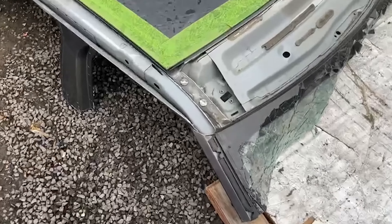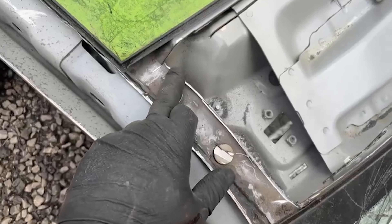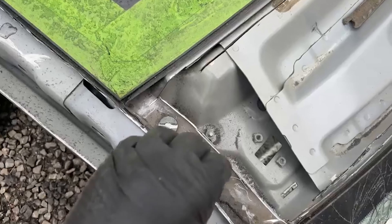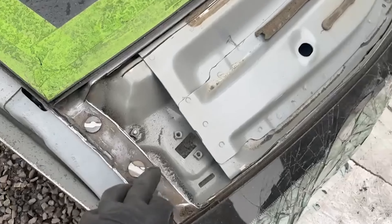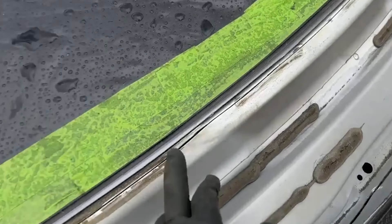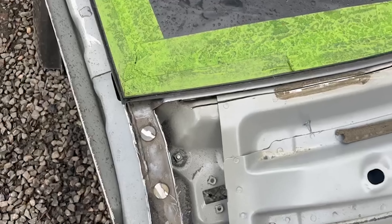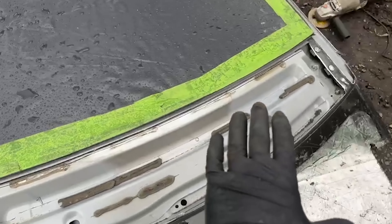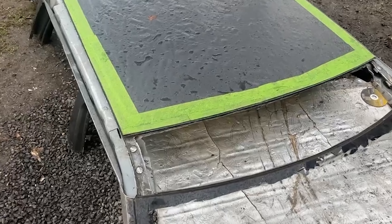Just a little update - I've cut these ends up here. I try not to get too close to the end; I cut to about there and then just go back and forward to fatigue the metal and it breaks off. I've cut it along here and then at the top, and then what I want to do is go down like that to get this bit of reinforcement metal out of the way. And voila!